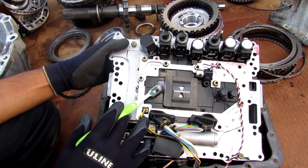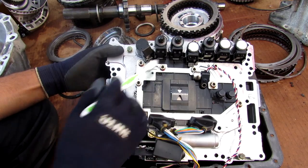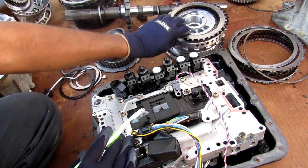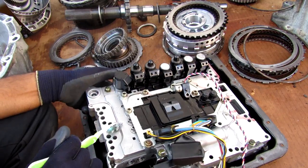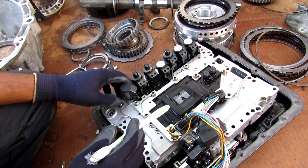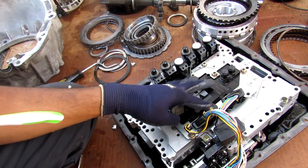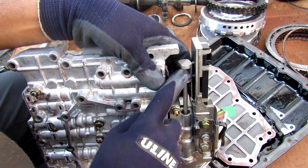Another big failure point in automatic transmissions is the valve body and the computer that controls it. The computer is completely submerged in transmission fluid by design, but they do fail and might need to be reflashed or relearn your driving cycle. The valve body uses transmission fluid as a lifeline — without proper fluid it can't send the correct pressure to the clutches to lock them up properly. Those clutches are controlled by individual solenoids that redirect fluid inside the valve body according to the computer's demands to lock up the appropriate clutches for the gear required. If a solenoid fails you could get a transmission code or symptoms of a slipping transmission — but luckily solenoids are easy to replace by just dropping the valve body, no need to disassemble the whole transmission.